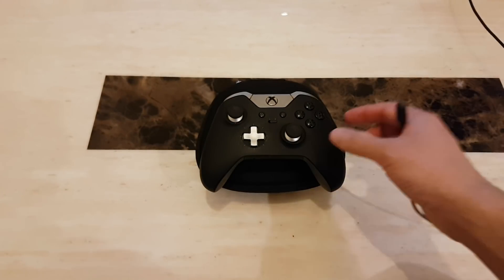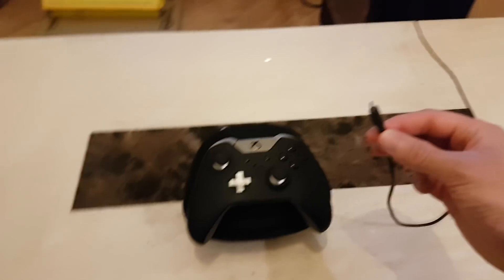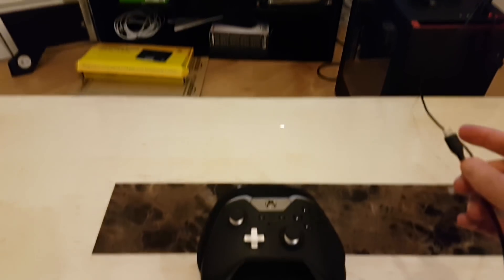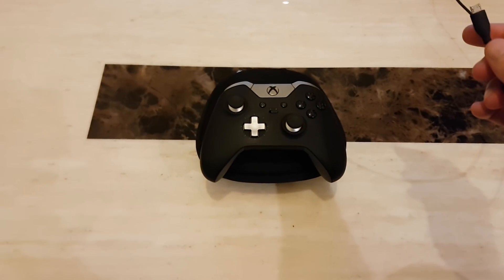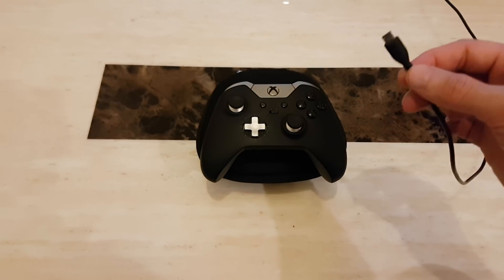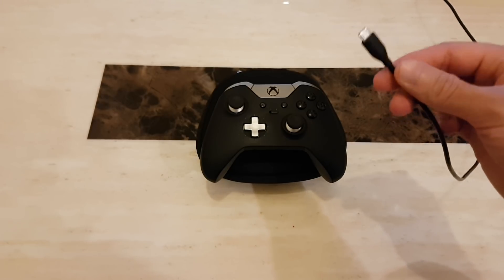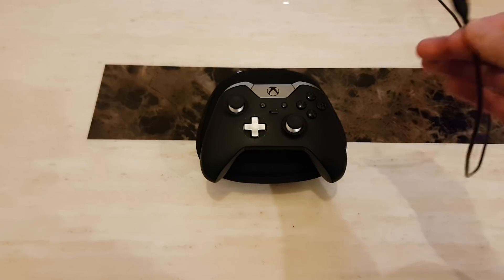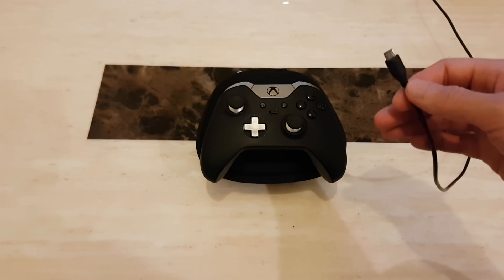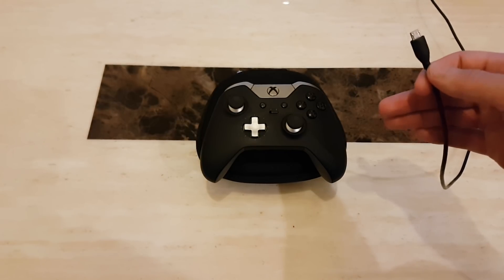For wired connectivity to the PC, we'll be using the controller and a micro USB cable, which I already have connected to the front IO USB port of the PC. We also need to make sure that this micro USB cable supports both data and power. If your cable is only transmitting power, it will not be able to find the correct driver, resulting in an error and the controller not syncing to the PC.